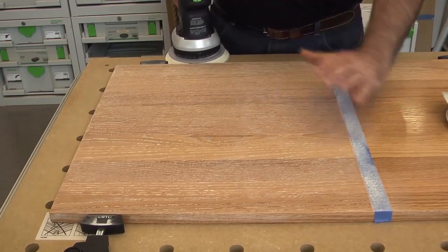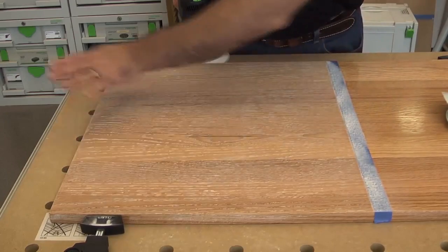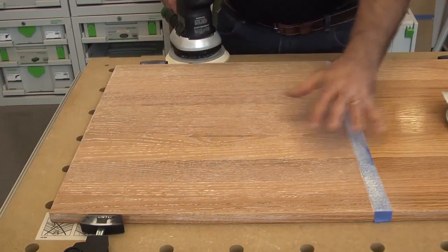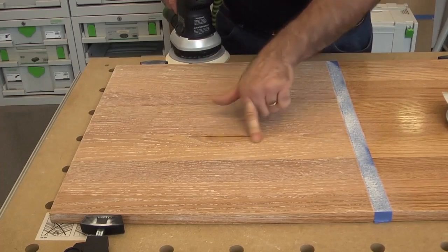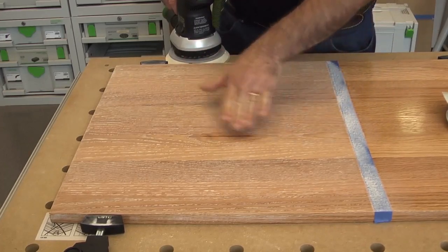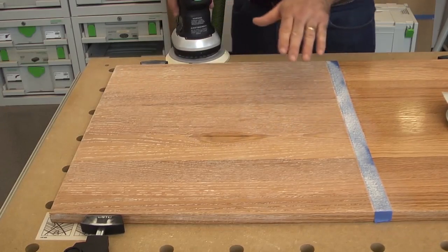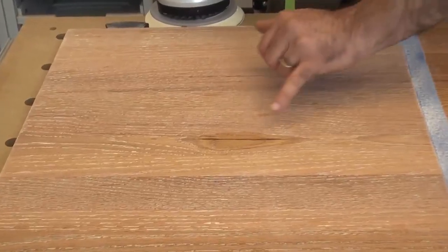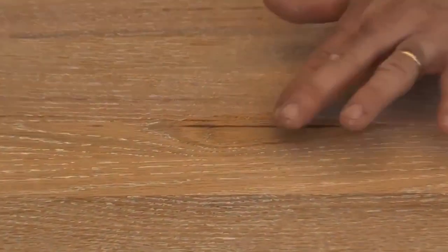Sanding technique is essential. You want to go back and forth, to and fro, in 6 to 8 inch circles. That overlapping, that way there you cover the whole surface. What we're looking for is when you look at a spot like this, and hopefully the camera's getting it, sometimes you have to even start lower if you're spending a lot of time on 800 grit, because you'll see shiny and dull, especially in a flat area right here. You want to make sure it's all dull. The low points will be shiny, so you want to make sure it's flat.